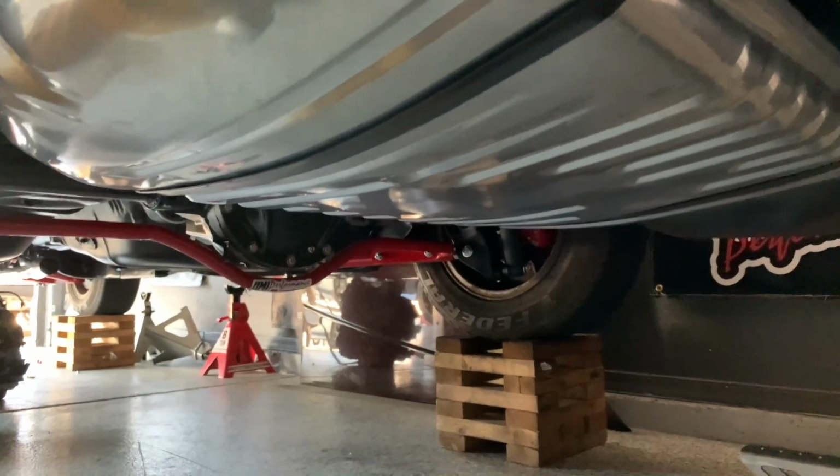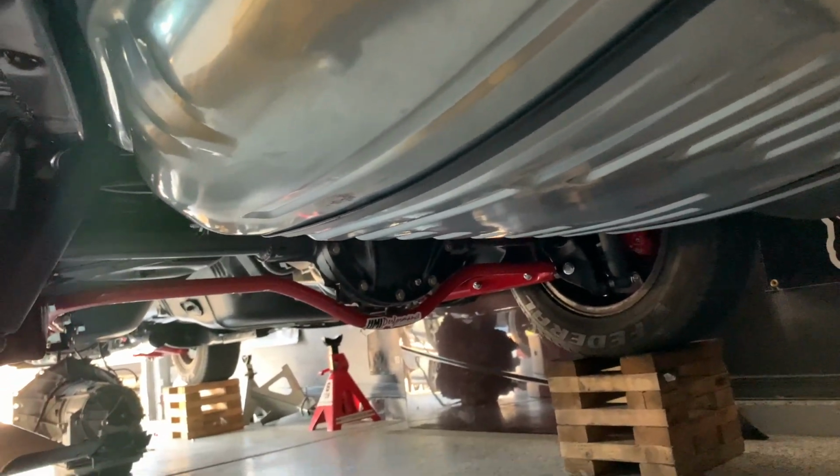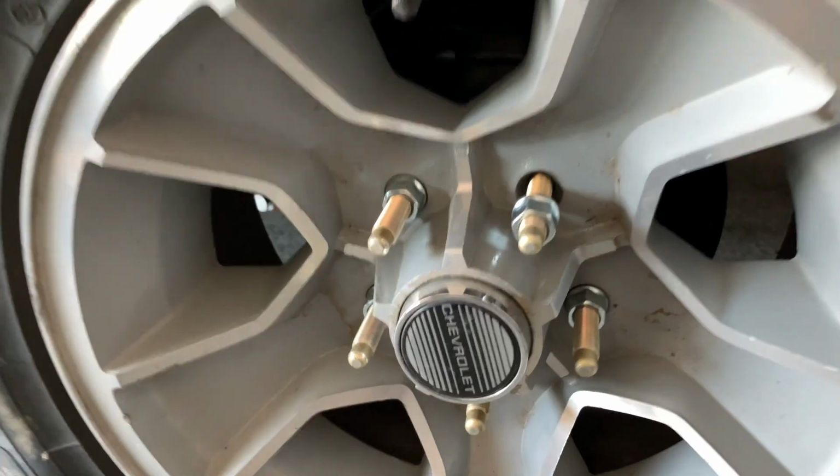We have a Tanks Inc. EFI tank. Now the tank has to come back out. I still have to put the strap liners on the tank, which is really important that you guys run those strap liners. They can be, you know, linked to some of the car fires that are out there. So run those strap liners. I'm actually gonna create a harness off of this tank with weatherpack connectors that plugs into the harness that we have coming back here for the pump and the sending unit. So that's what's up next in the back here. But all in all, this car is pretty nice.